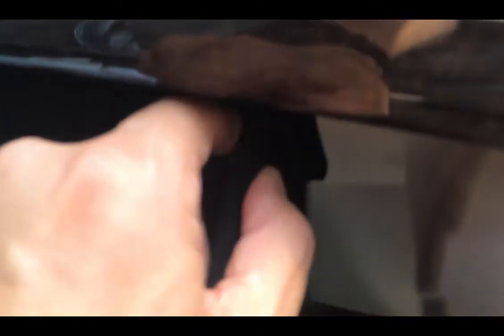Now there's a couple of clips here on the side. You have to drop the glove box here. Push that in, and push the other side in, and it drops — and dumps everything out of my wife's glove box on the floor, which works out great. So there's the filter.